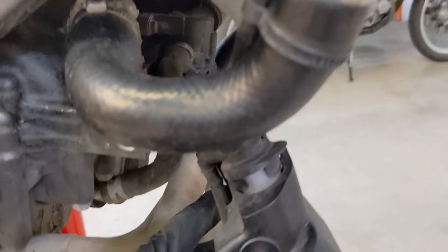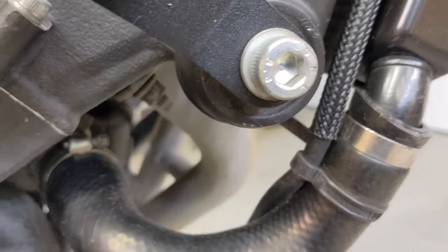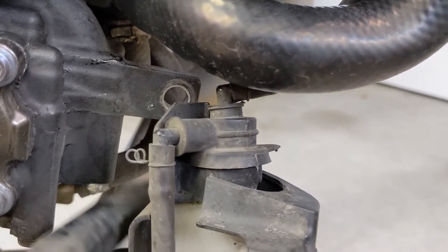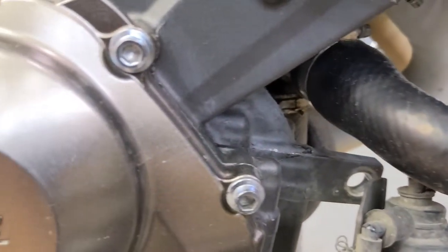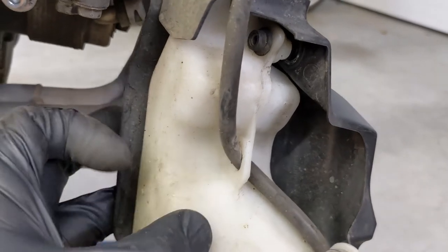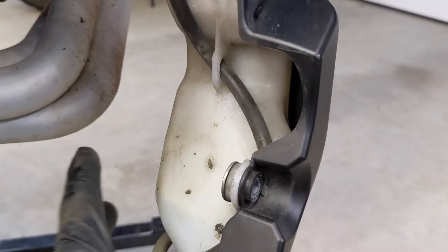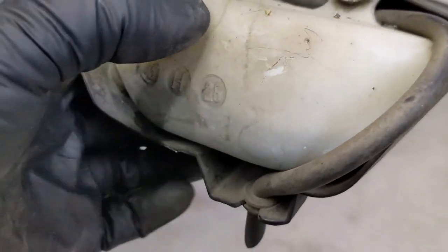The hose goes behind this hose, and if you look under here you can see it coming down behind the hose and then it actually goes into the reservoir cap. It looks like it tees — one goes into the plastic bottle and the other one comes down, off the cap, and then down through this little hole. Then it goes along the front of the bike — that's that bolt we just took out, the one towards the rear, the 5mm one — and it clips in right there.